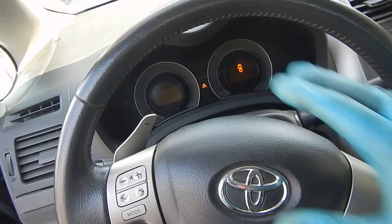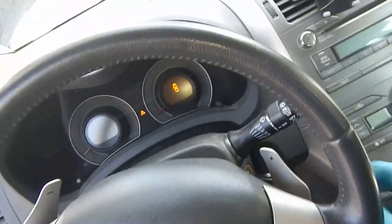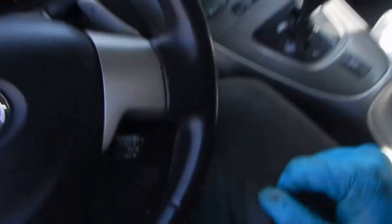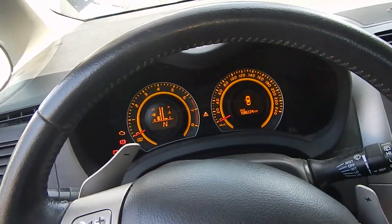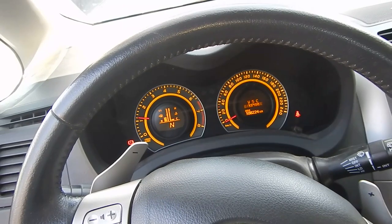Wait about 10 seconds until the dashboard turns off. Without brakes, turn on the switch. I hear some noise from the clutch actuator — very very good. Now push the brake and start the car — the neutral indicator must flash a few times and then light on steady. Learning is done.